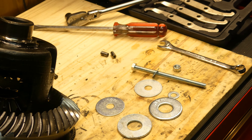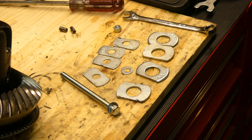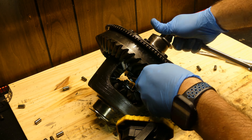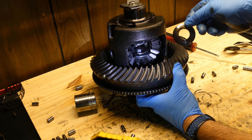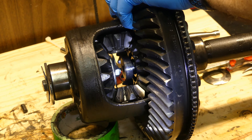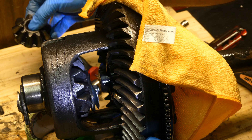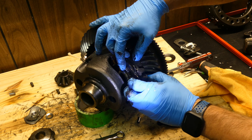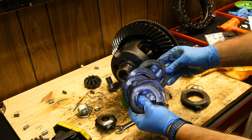At this point you're going to need some nuts, bolts, and washers in order to compress the clutch discs. Install the bolts with the washers on the ends then tighten them down to compress the clutches — make sure you do both sides. With the clutches and gears compressed, the spider gears are loose enough to get the shims out of the back. Be sure to mark these gears as they should go back in their original spots. I shoved an axle through one side and spun it against the differential housing to spin the spider gears out. Remove the bolts, all gears, clutch discs, and clips, and make sure the case is clean and free of any damage. Inspect the clutch discs for wear — mine were still in good shape but will be replaced anyway. Inspect the gears for wear as well.